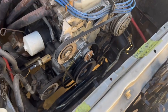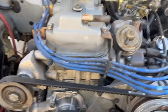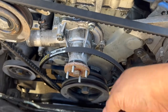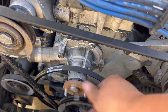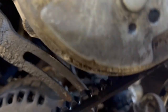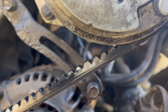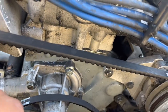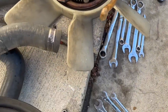If you don't know how to remove the radiator, it's pretty simple on this 2.6 and most of the older vehicles — it's the same. First suggestion: loosen up these nuts right here, because once you remove the belt from the pulley it's free to move around, so just loosen them up, you don't have to take it completely off. Then there's down here an adjustment bolt on the alternator bracket, so loosen that up too so you can remove this belt. Once you do that, remove the bolts — the bolts that hold the fan clutch and the pulley.